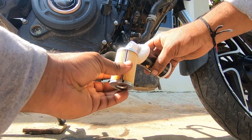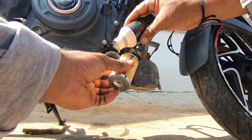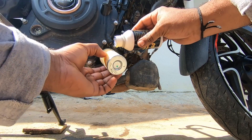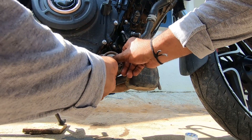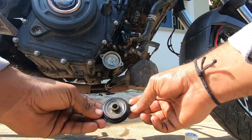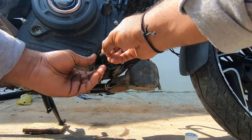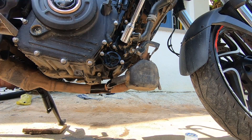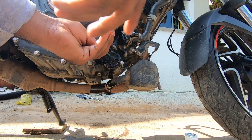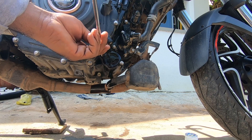Fill oil from the 100ml loose bottle and fill some here as well — just making it a little soft and wet so it performs instantly. Also, when you take the oil filter out, they'll give a new rubber seal — make sure to remove the old one and replace it with the new one. Lock it and insert the cap back. Don't tighten it too much, as the oil seal might break if you over-tighten it — it is a rubber ring.